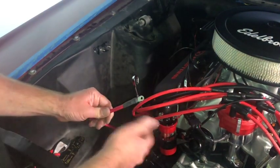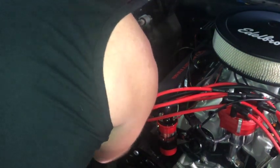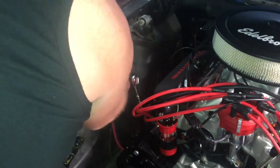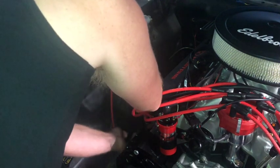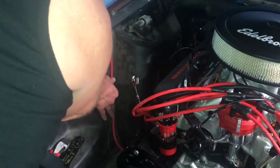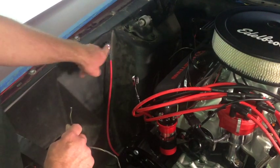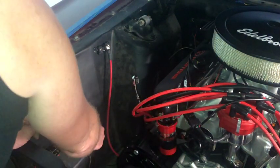I ended up getting a slightly smaller terminal and getting it to crimp on there. Then I'm going to run it where I was going to. I'll put it on there and it'll start forming to where I want it. I might have to use some clips to get it to stay there, but I want it to follow that line. Just a correction — 916 from the harness goes to this side actually, and then this side will be more of the battery cable that goes to the battery. So I'm going to strip this and put one of these little already-insulated deals on.